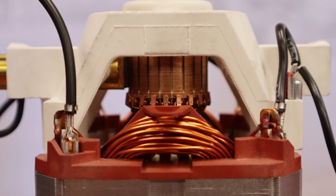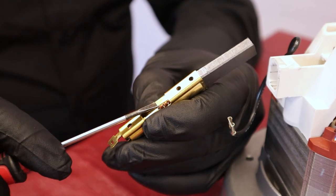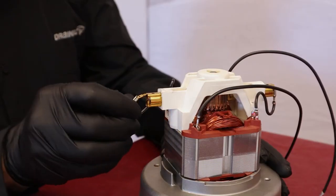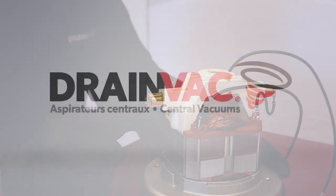If the rotor is in good condition, put the new brush into place. Never touch the tip of the brush. Carefully lift the middle tab with a flat screwdriver. With the brush back into the motor, reconnect the terminal and fold the connecting wire.